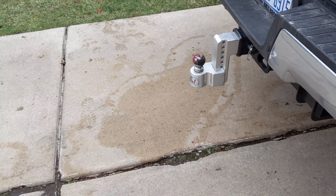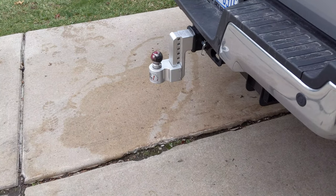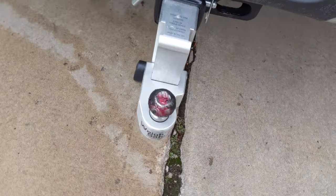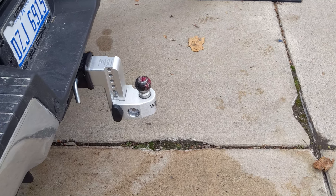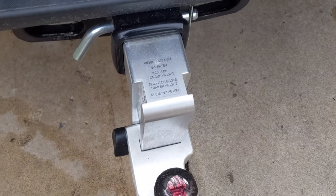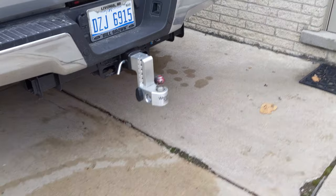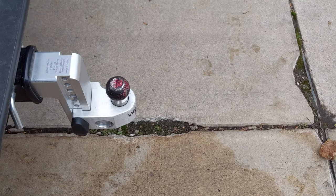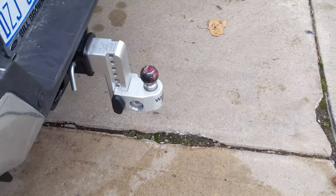I don't know if Gen Y has a scale, but if you're hauling heavy daily and looking for something that's not going to ever wear out, maybe a Gen Y hitch is better. That said, Gen Y hitches cost more than WeighSafe hitches, and by the time you catch up to the cost of one comparable Gen Y hitch you'll have probably replaced a couple of these $77 lower sections. Also, Gen Y hitches are rated higher — some go up to 32,000 pounds — while this WeighSafe is rated for 21,000 pounds and the F-450 is rated for 26,000 pounds, so that might force you into a bigger hitch if you're trying to tow closer to that 26,000-pound max.